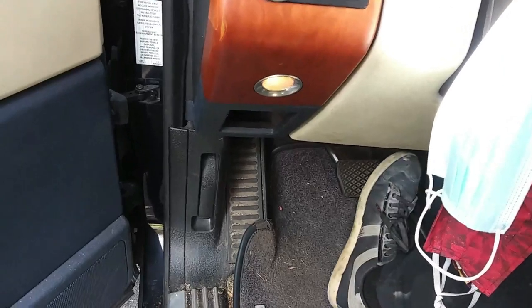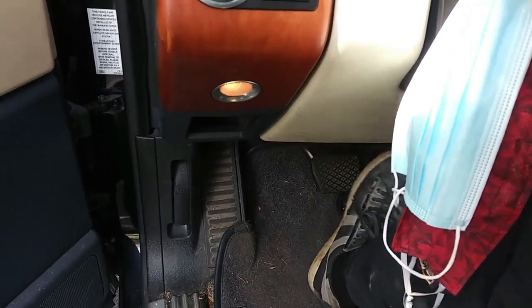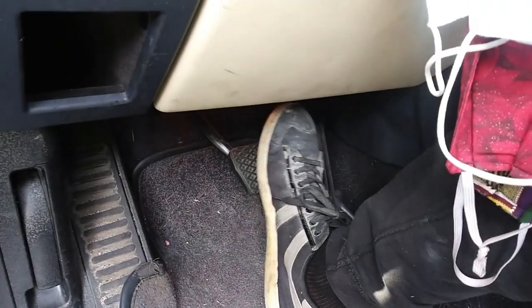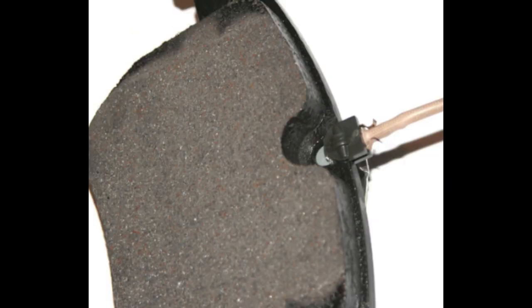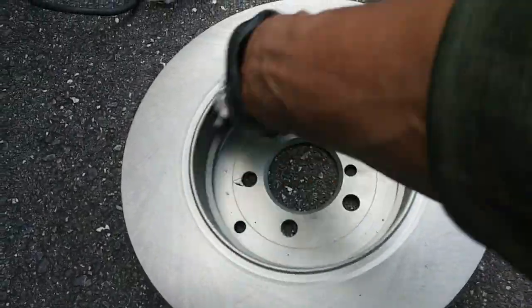Once I'm done, I always pump my brakes up — pump the brake at least four times. Don't press hard until you pump at least two pumps; on the third pump you can push down a little harder to make sure it's nice and tight. Once the brake pedal is nice and tight, you put on the wheel. Also, I lost some footage — this is a quick showing of where the new brake warning sensor goes, popped into the brake pad.